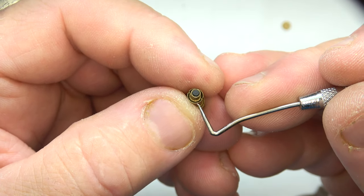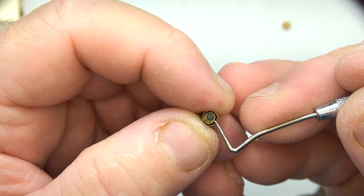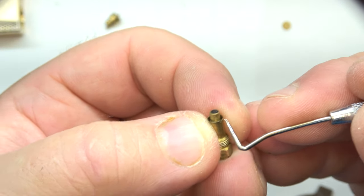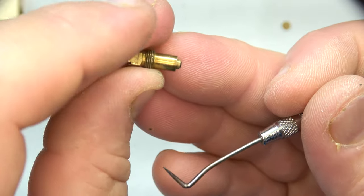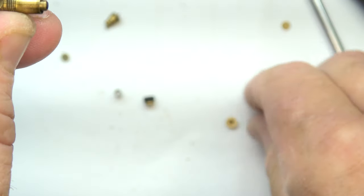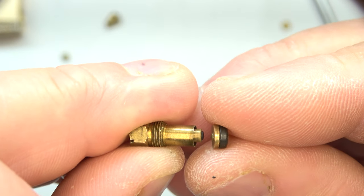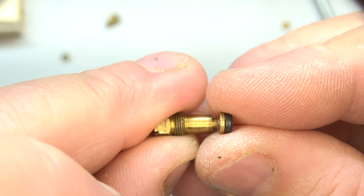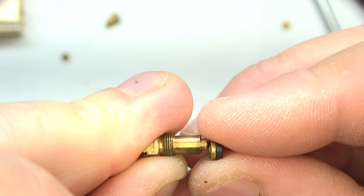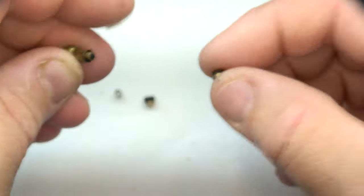I've cut some seals off of parts I got for these — when the stopper is no good I actually have to use two of them because they're thinner. You want that rubber to stick out about that far past the brass — the rubber has got to be out past the brass. If the rubber is not past the brass, you might not get the stopper to shut the gas flow off at that orifice. Keep that in mind.